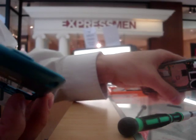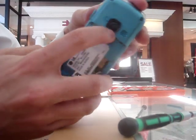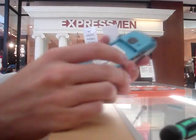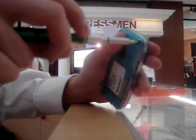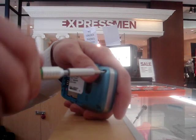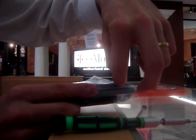You'll want to take your buttons and put them back in the appropriate places. Now, take your actual back piece. What I typically recommend is going in from the top, latch in, go here at snap, and then just push all the way around — it will snap into place. You have one, two, three, four, five, six screws you have to put back in. Make sure that all of these screws are put into the proper level of the phone, because there are different sizes for different levels of the phone, which is why I recommend keeping them separated out as you do it. After you have installed all six screws, your phone should be completely assembled again. Make sure you've got your buttons in the right places — they slide right into place. You want to do that as you're putting in the back piece.